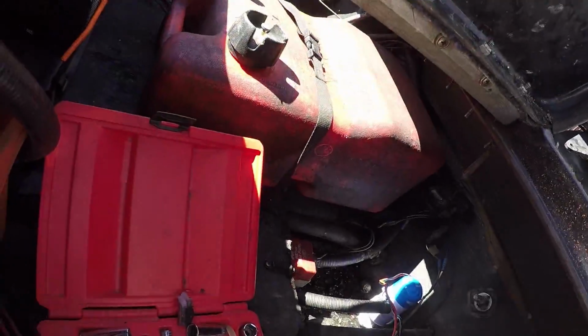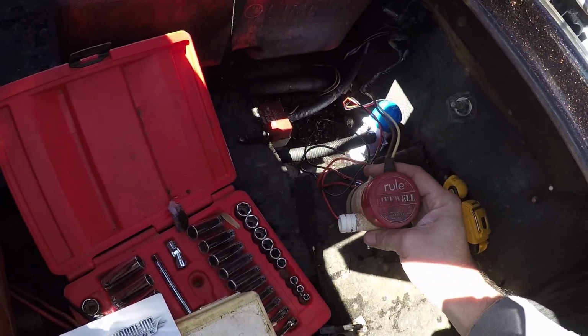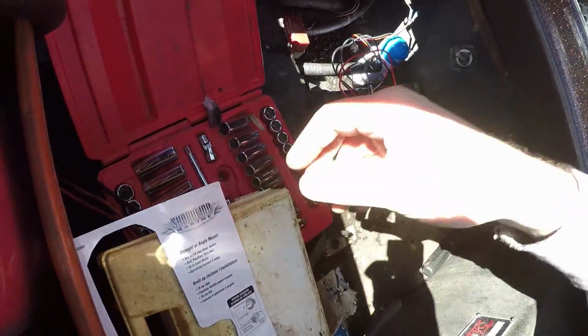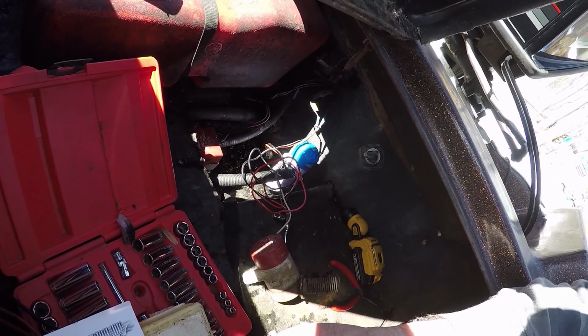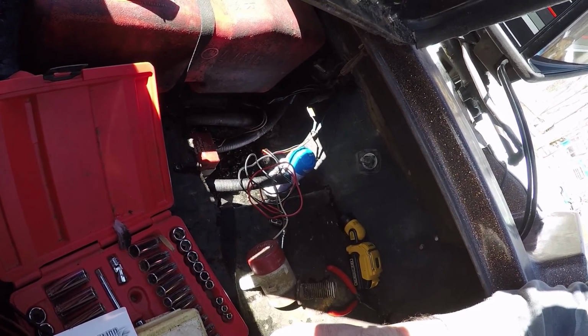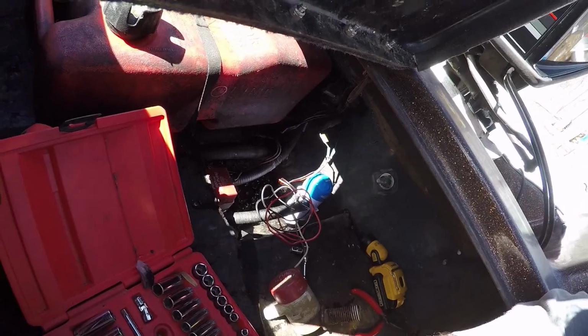Notice that there is a fuse on it. Now, this is a 2-amp fuse. That is saying 5 amps. So, I'm gonna need a bigger fuse. That is for sure. So we're gonna see what we got, and see what we can work out here. All right, so give me a minute while I go take a look at what I got and see what I can make work.